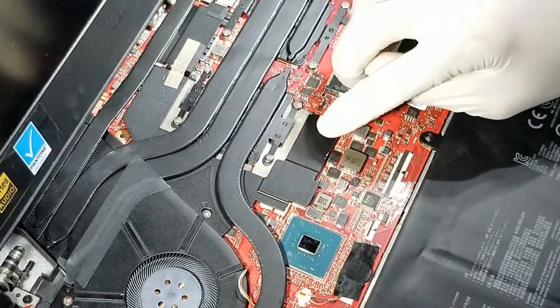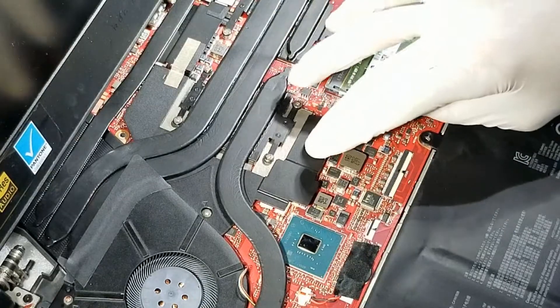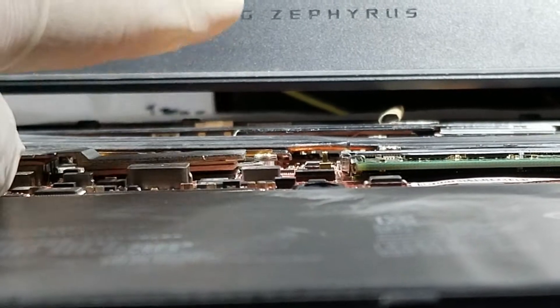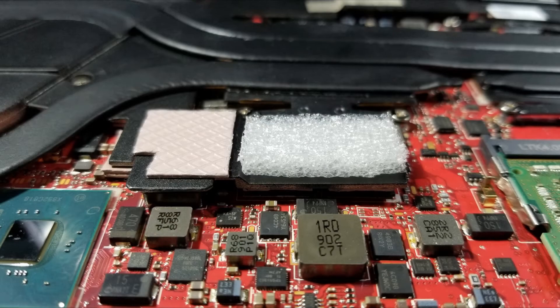As you can see here, because the pads I used are not sticky type, this area of the heatsink is not touching the memory, which could introduce an overheating problem to the memory IC chips. ASUS should have made a screw somewhere to hold this in place. However, I made a quick solution — I added a pad over the VRAM which will hold the structure down against the top cover, and a foam to the other side. Make sure that the pad and the foam are leveled, as they will press this section into place. That should solve the issue for now.